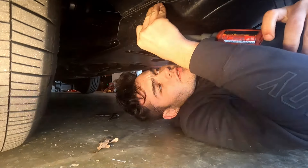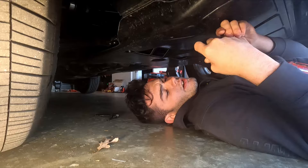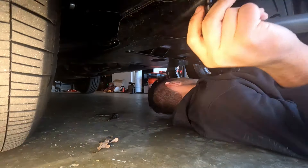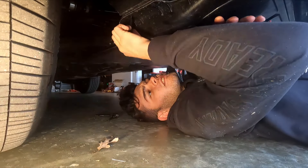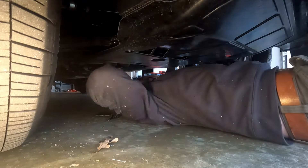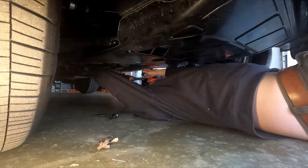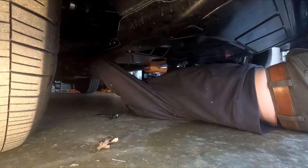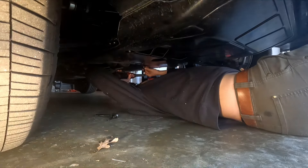There's a belly pan plastic removal tool — which I ain't buying. In five years when the warranty expires, people start taking them to quick-lube shops and I'm going to have a bunch of these with holes cut in them — I'm doing that next time. You've got to use a 36mm socket to get the filter off. You can't use an oil extractor because it goes into the oil cooler, since the oil cooler and oil filter are all one. And you literally cannot put this car on jack stands without taking this belly pan off, which leads me to the whole right-to-repair question. Like a freaking iPhone. If you don't have a lift, it makes it unsafe to work on.